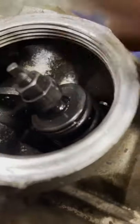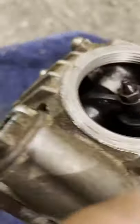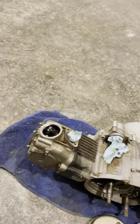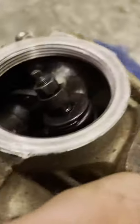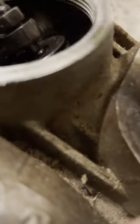At that point, the nut here is a 5/16ths. You're gonna need a 5/16ths wrench and then a pair of pliers or something to grab the top of this stud here. What you're gonna do is loosen up that nut and then measure the space between that shaft and your valve. This one's actually a little tight. Yamaha calls for three thousandths to five thousandths — I use four thousandths.